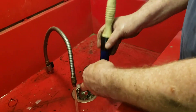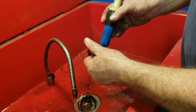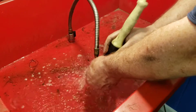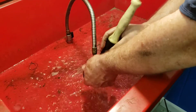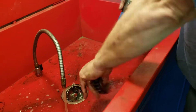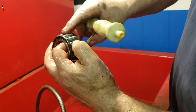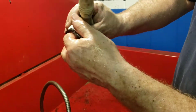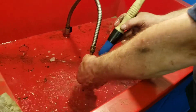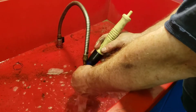Now as I roll the bearing, I can see grease still coming through — that means I missed some. You can hear the rollers rolling. After I get all the grease out I want to inspect the rollers. I want them to be nice and clean, no pitting — roll them around and they should be smooth. We have my daughter Reese on the camera today helping out.